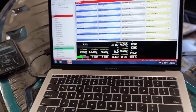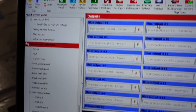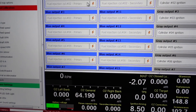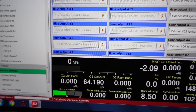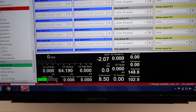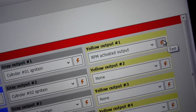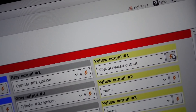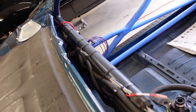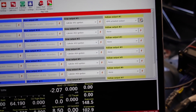I wanted to show you guys what I was talking about on the testing. When I first got it going I wasn't having any spark. I want to show what FuelTech does — these are all the outputs on FuelTech and you can go in and test those. If you listen closely, here's the little test button — you can hear the injectors clicking. You can go through and test all of these to make sure all your wiring's good. Same with the coils — they have an RPM-activated output that turns on the coils. I had this unplugged, which is why it wasn't working. When I click this you can hear the relays clicking on inside the car. It wasn't giving power to the coil relay, so it wasn't getting spark — that's why the car wouldn't originally start.